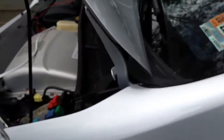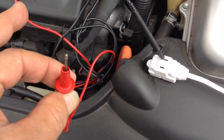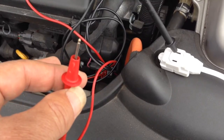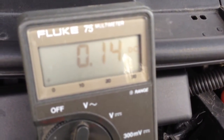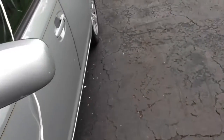Opening and closing the door activates the computer. I also realized my meter probe was disconnected — once disconnected, no electricity flows from the battery to the car, so the car is basically dead and the trunk door will not open. I have to reattach the probe. Look what happens to the meter when I plug it back in: as soon as the probe is attached, electricity flows, it wakes up the supervisory circuit, and then current goes back to zero. Be aware of all these little things. Now let's try to open the trunk door — and it did open.